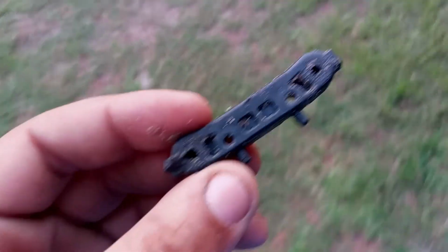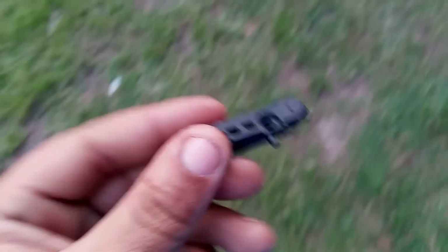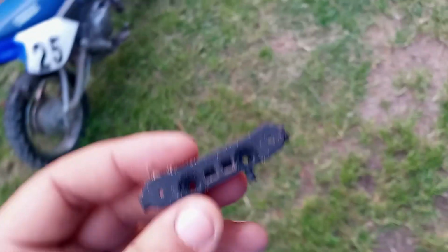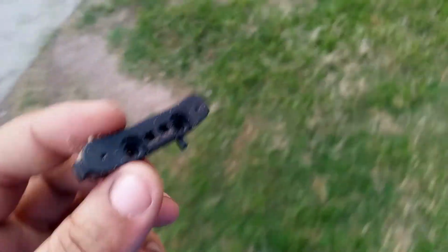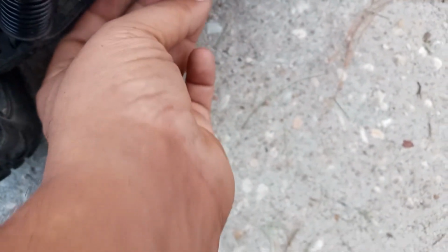And it's not the truck's fault that this fell out either, because you remember when I said I forgot I was going to drive it without the wing? Well, the bolts that hold this in are the same bolts that hold the bottom of the wing in. These pins go in these holes on each side. These 2 little notches on the bottom, these 2 feet, they go in the holes here, and then the wing bolts onto the back here.